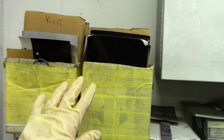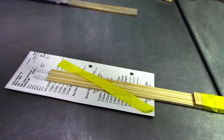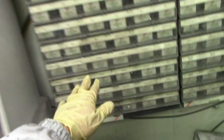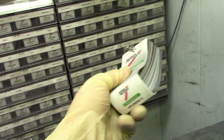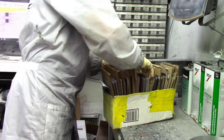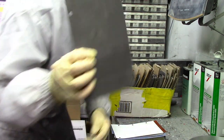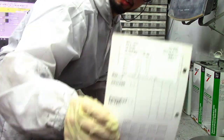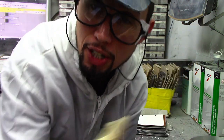I made a video before on how I spray my spray panels and store them — I like to have bigger panels. The computer gives me options to go into these panels so I can check the variants. It tells me to go to Hyundai 3, and over here I have a chip chart that tells me what colors I can choose from these variants to mix them. I found one I had already made, and found another one — two panels to check. I have a video on that you can check out.